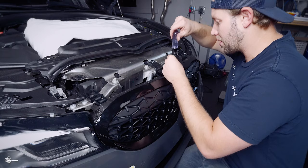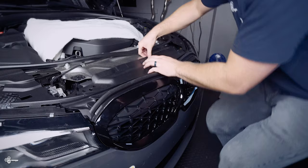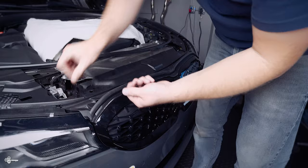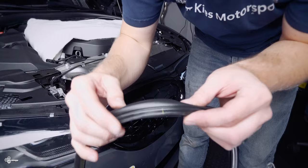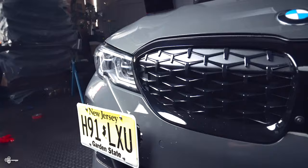Once you've done that, take your T30 and put that back in. The trim piece has three little series of clips, so just press down on those. Then take all of your little plastic fasteners, put them in, and reinstall your weather stripping. BMW typically puts a mark in the middle just to help you line everything back up. Once you've done that, you're done.